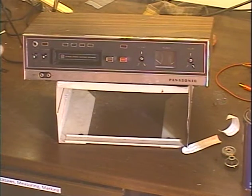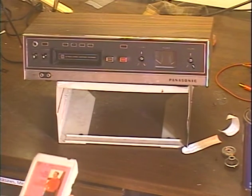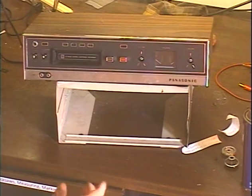I don't recommend ever even touching the fast forward button on an 8-track. When the tapes were new, yeah, that was fine, but with tapes being 40, 50 years old, they've lost some of their graphite coating. They just have to be packed evenly. There has to be the right tension between here and there, and blah, blah, blah.